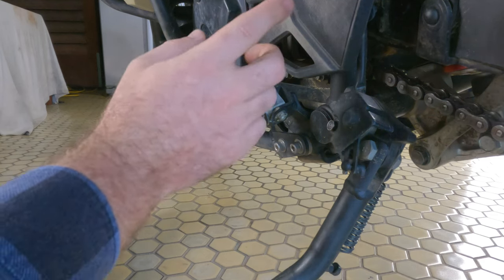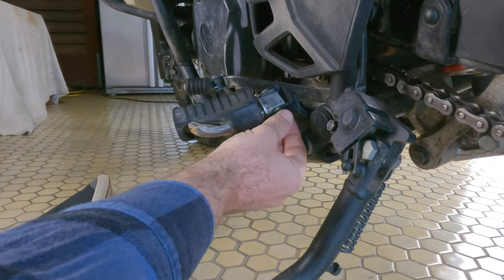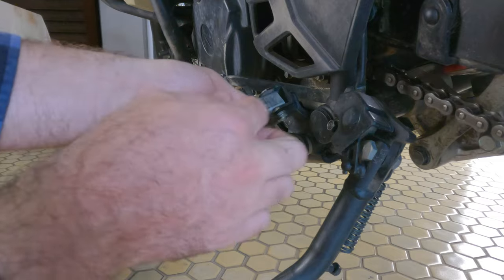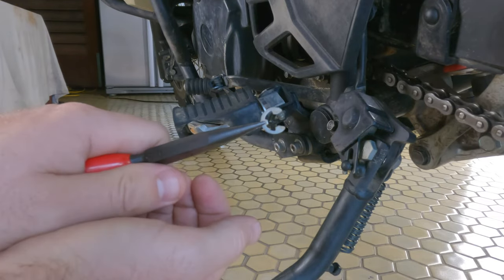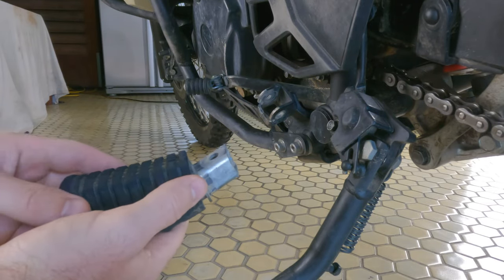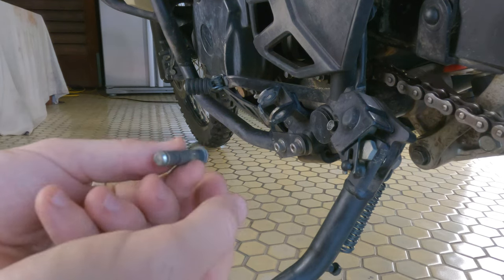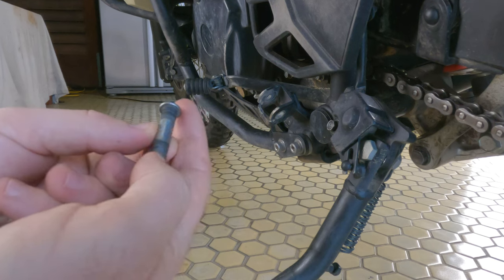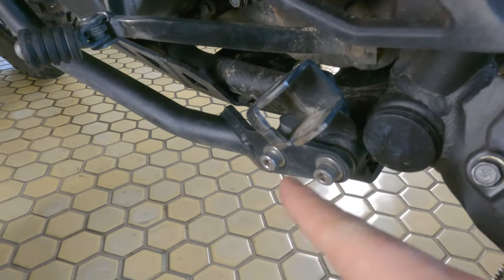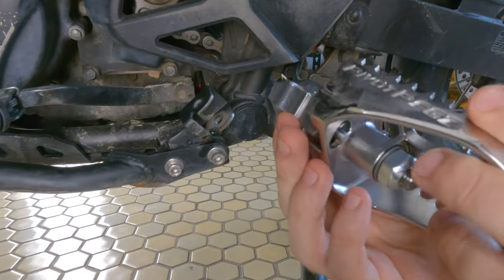Let's get these suckers off. These actually don't have a split pin — they have a circlip, so they're really easy to get off. All you do is get some needle nose pliers or any kind of pliers and yank them off. I'm going to push that out, pull it out and throw these in the bin. I'm going to give the pins a little cleanup just in case — they're pretty good, but why not? It also doesn't hurt to give all this a bit of a wipe out with a damp rag. Get in there and give it a wipe out.